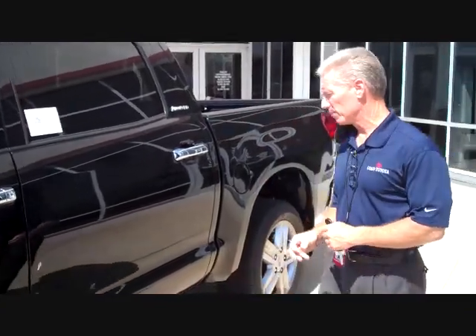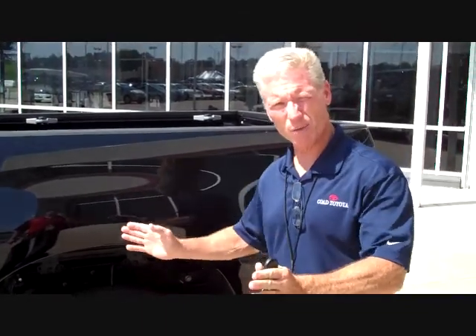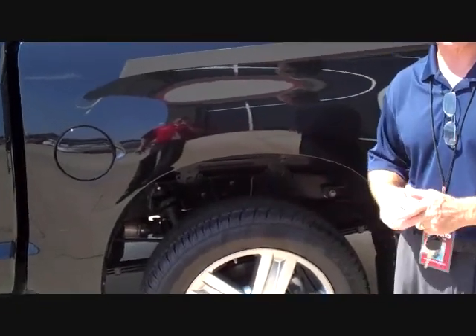Walking on back toward the side of the truck — you can't see it, but underneath the truck it has a triple-tech frame. It has a fully boxed frame in the front, a reinforced C-channel in the middle, and an open C-channel in the back. This allows this truck to become a real workhorse. We also have trapezoidal mounted springs underneath, which adds to the stability of the truck — wider in the front, more narrow in the back. And the shocks are transverse mounted, which reduces wheel hop in the case of heavy acceleration.